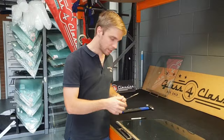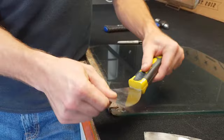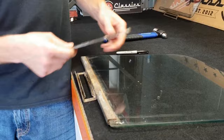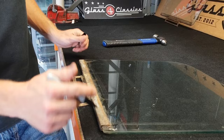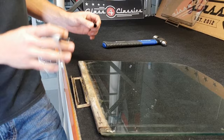So what we're going to do, we're going to come in here and sit this flat on here. Get the good quality ones — they're a little bit thicker. The cheap, nasty ones you can get for paint scrapers are flexible, the blade doesn't go all the way through, so that's not going to do the job. We've got our trusty old one here, it's about 2 inches wide and a little bit more rigid, so you can give it a good bashing on the end. First, we're going to mark exactly where the runner is on the old glass — leave a line at the front and the rear so that when we pull this off, we know how far in the runner sat. In this instance, the runner is central, so it doesn't matter. If you need to, you can mark the back and front of the glass so you know which way around it sat once you've pulled it off.